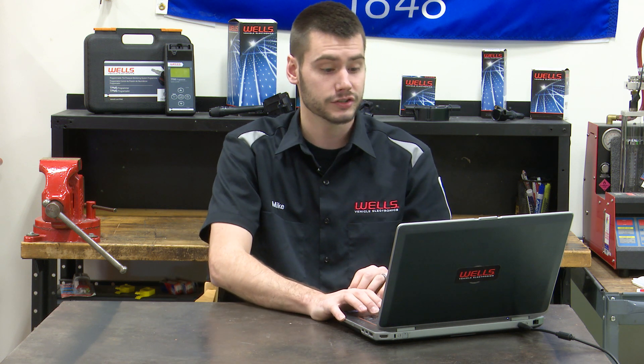Some awesome comments and questions related to the fuel trims class from our last broadcast. Jim said his intake air temp sensor is running 20 to 30 degrees warmer than actual air temp and his long term fuel trim is about positive 16 on both banks on his '99 Suburban 5.7. Well, if we stop and think about this it makes sense — the computer is reading the air as hotter than it actually is. Warmer air means the engine doesn't require as much fuel, so it runs a little lean. But that air is being falsely read, so the engine actually does require more fuel, and that's why the long term fuel trim ratcheted up to positive 16. Basically, an air intake temp sensor can cause a lean condition — that 20 to 30 degrees of error can translate to a positive 16 fuel trim, and it all depends on the vehicle.